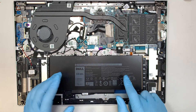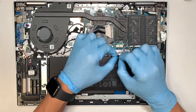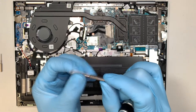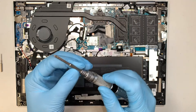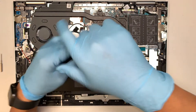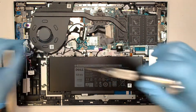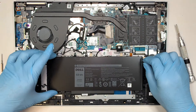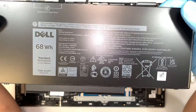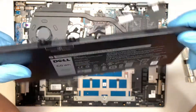To remove the battery, first disconnect the connector by simply sliding it down. Change the screwdriver to the PH1 size — a larger Phillips screw head. Remove the two screws here; the black one will stay by the battery. You can just lift it straight up and that's how you remove the entire battery. The replacement part number to look up is 3HWPP.